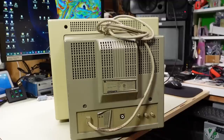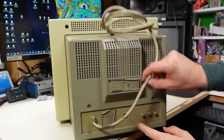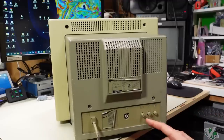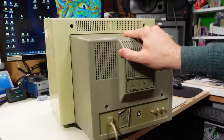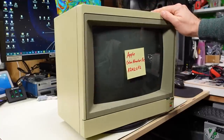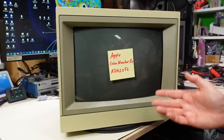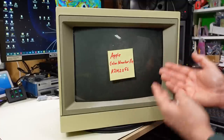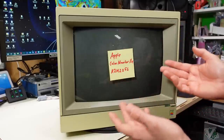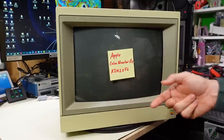It's got a fixed power cord, which is really dirty. The label says Apple Color Monitor IIe with the model number I already mentioned. It's got a single composite video input, and then we have horizontal position, vertical position, and vertical size controls on the back. This is an NTSC monitor for North America at 120 volts - it doesn't have a multi-voltage power supply. I'm pretty sure they also sold this in PAL markets, like Australia and maybe the UK. There are a bunch of different weird Apple IIs that run in 50 Hz markets - some output PAL, some output no color, some output NTSC color at PAL frequencies. I think there are matching monitors that go with the matching IIes sold in those various markets.